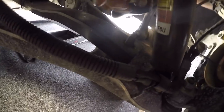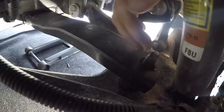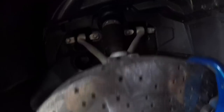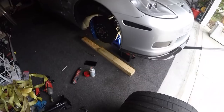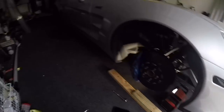There's the bolt right there. There's a little rubber piece on the bottom that pushes on the control arm. This one is in your leaf spring, so backing it out counterclockwise is going to lower the car. I'm going to back it out all the way. The jack stand takes the pressure off the leaf spring so the bolt doesn't have pressure on it, making it easy to back out. There it is — backed all the way out counterclockwise. That's as low as it's going to go on stock bolts.